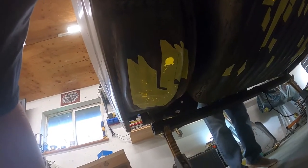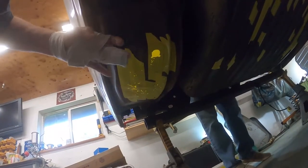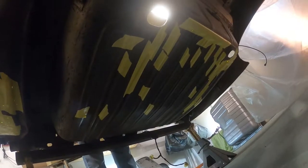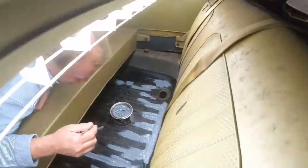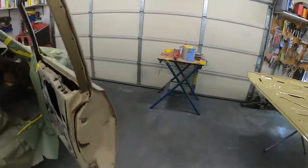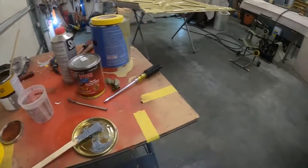It's a 1970 Chevelle wagon, so if somebody has an idea let me know — or maybe an Impala wagon. The spare tire area just has rust on the bottom. The floor pan inside looks like the bottom of a gas tank — it had water sitting on it, was patched once before, and we couldn't find a replacement in time. We taped up the rust holes after treating them with Mort rust treatment, then seam sealed over the top, and we'll hit it with POR-15 after the seam sealer dries.